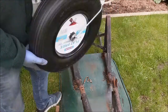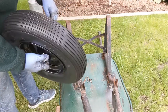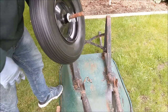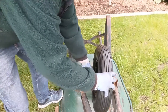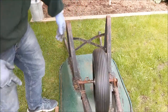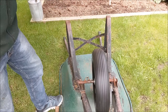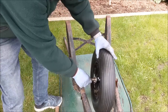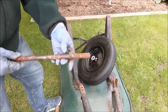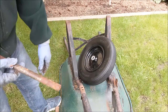Let's get back at it. I got the packaging off the tire — very exciting, did not film that. What I'm going to do now is just a basic test fit. I'm going to take the old shaft, put it in, make sure it's the right diameter. It's 5/8, and sure enough it's the right diameter, so that's good. I'm just going to test fit this to make sure the wheel will spin, because it would really be a downer to do all this work and find out it bottoms out. Yeah, that is going to work. Now what I'm going to do before I put it back together again, just because it's very little effort, is go into the workshop and clean up the axle shaft. It's got sealed bearings so it doesn't really matter too much, but I'm just going to wire wheel that thing.